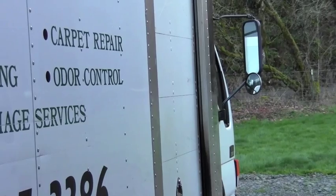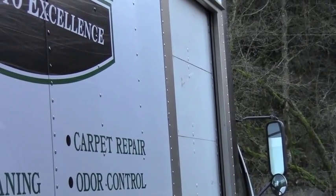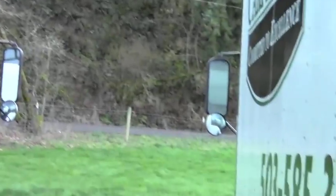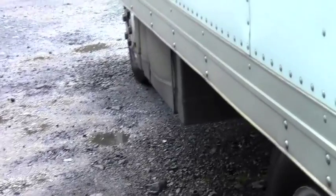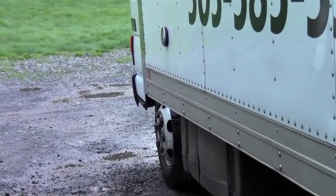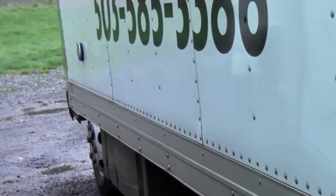This is the '04. We've got the wooden side door, which is different from the '05 which has metal. This one, since 2004, is just now starting to see some paint peeling off, so when I repaint the back door on the '05 I'll go ahead and take care of that as well. One thing we also use is 24-gallon gas tanks mounted underneath — that's what feeds the Everest. We've got the filler neck right on the side, and always put the filler neck on the same side as your diesel so you can pull into a gas station and fill up the diesel and gas simultaneously.